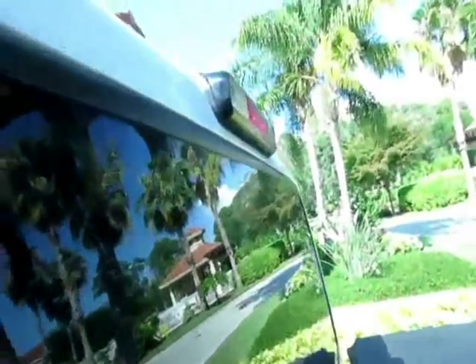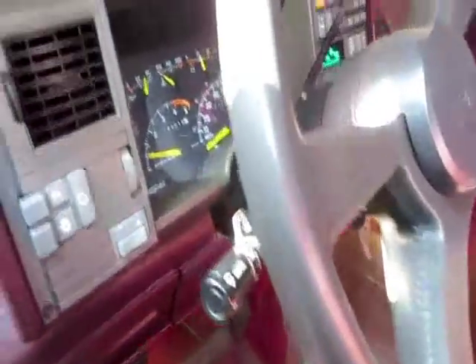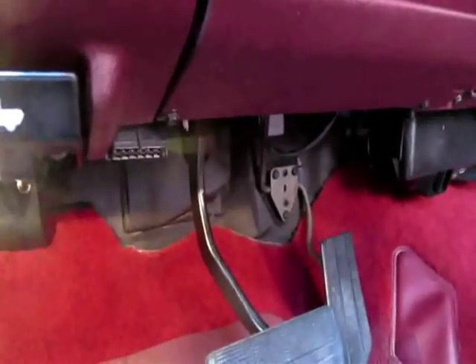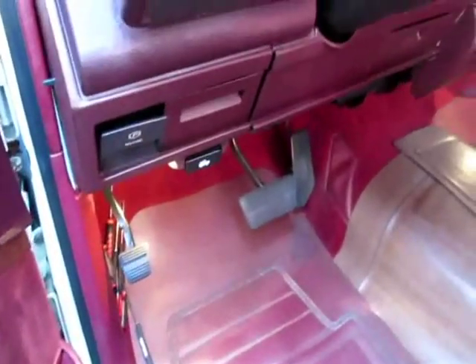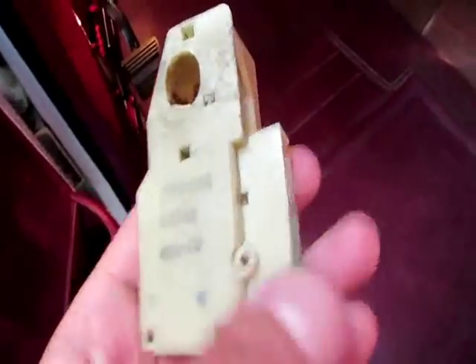Battery is low but the switch works — you can check it by looking at your third brake light. Stay positive, and when you call your old truck a piece of shit, don't — fix it up. These trucks are probably better than a new Chevy truck. Hope this video helps. You really can't show much without taking the column out but you can do it either way. Use a good part — AC Delco, Delphi, whatever — Chinese ones won't last. You can hear my belt squeaking and my tensioner squeaking — another project. The alternator bearings are going too. New parts are not always better.